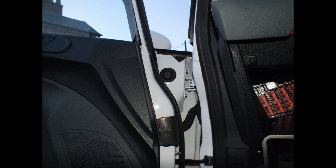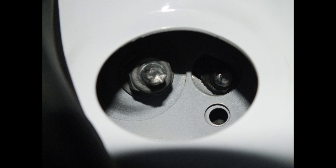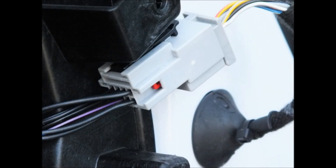When the time comes to replace the mirrors, removal and installation isn't too bad. You should see a rubber grommet that I've highlighted on screen — if you remove that, you will find the nut that is holding the mirror in place. Simply undo that and the mirror will come away from the car, so make sure you're holding it. Then simply undo the connector, feed that through the inside of the door, and it will come straight off. Installation is just the reverse of that.